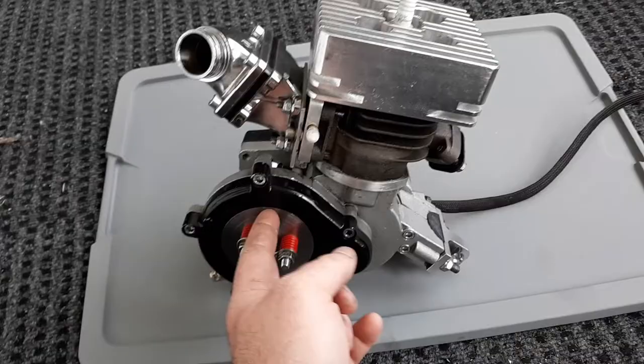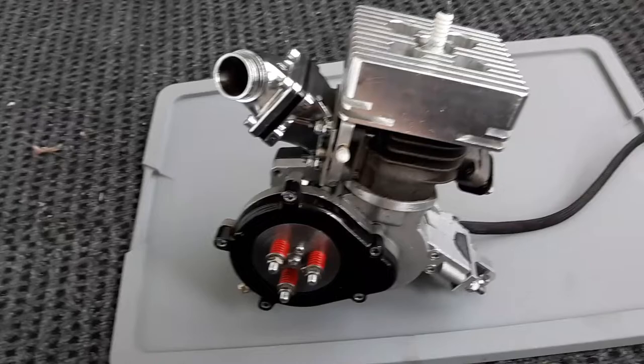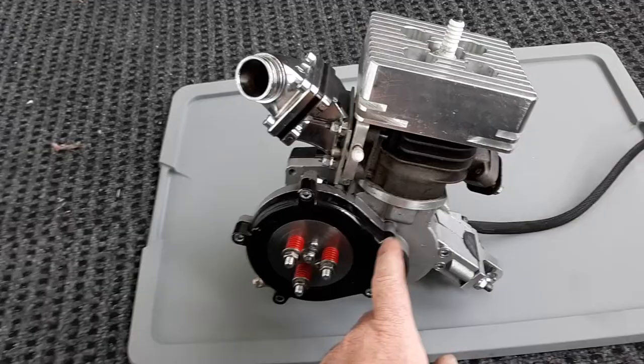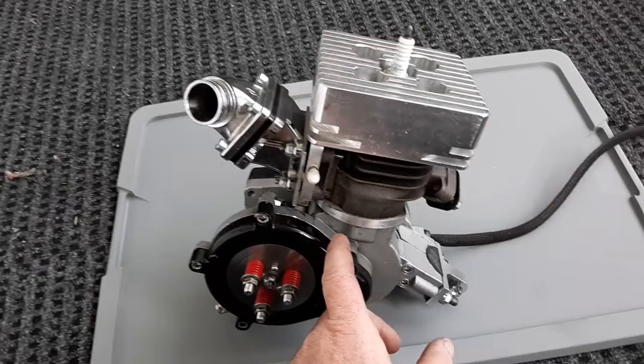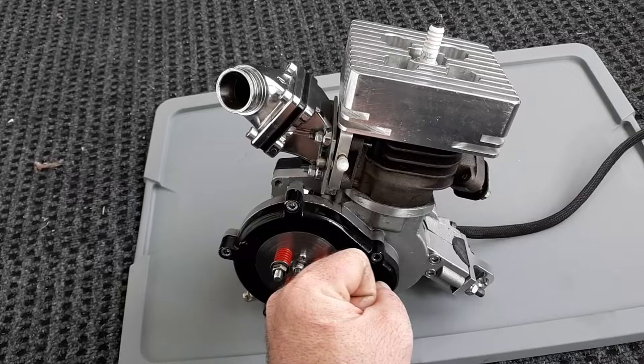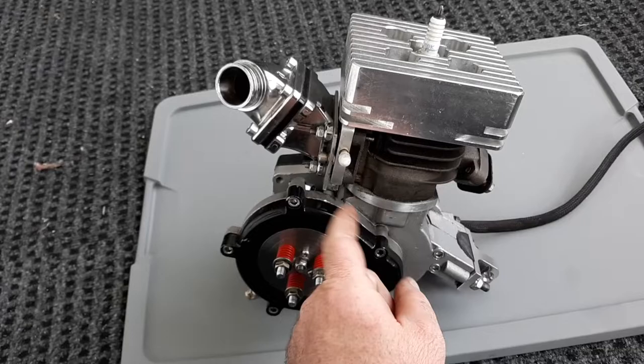These are not like the China doll kits. You're gonna be losing clutch bearings for the shaft — this one right now is on the second set. I went about 260 miles. Also, a lot of people are leaving the seals on the crank bearings when they build these, and they're selling them that way.